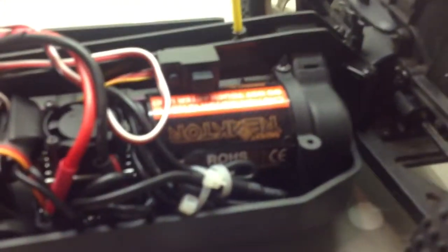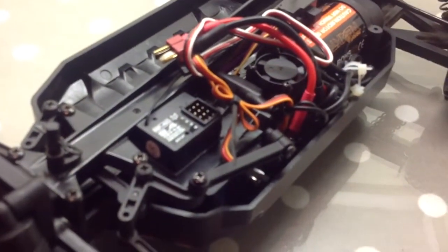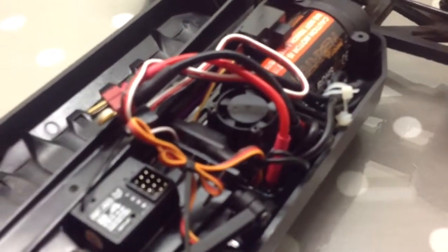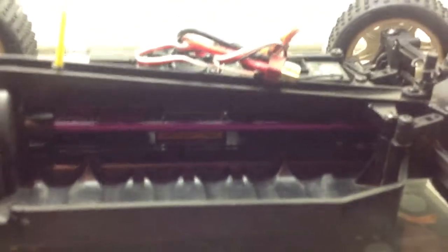At the back I've got the Helion Radiant Reactor brushless motor — a 3500kv 540 size motor. It's waterproof, and there's the waterproof ESC, although I don't think the fan's waterproof, so that kind of defeats the point. Down in there I've got an Alton servo — I'd like to tell you which one but I can't think of it off the top of my head, I'll put it in the description. There is an HPI RF40 receiver, which goes with my TF40. Got it second hand on the Model Sport UK forum pretty cheap — it's a five channel radio. Then in there is the purple aluminium center drive shaft, which replaces the plastic one. And some information on the ESC down there as well.